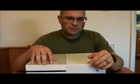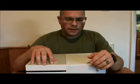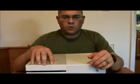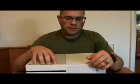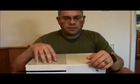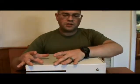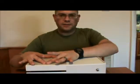Turns out these Blu-ray drives, if your Xbox One was manufactured between 2013 and 2014, roundabout now, depending upon how heavily you've used it or not used it, there's a solid 50-50 chance from what I've been reading on the internet, depending upon who manufactured it, depending upon the parts that are on the inside, it may be messing up with the Blu-ray drive. It may be doing this weird thing where it only brings the disk in about to right here, and it actually needs to be about right here, just a quarter inch further in, and it'll actually sit properly in the drive, it'll actually spin, and it'll actually read.